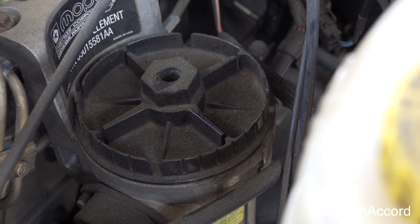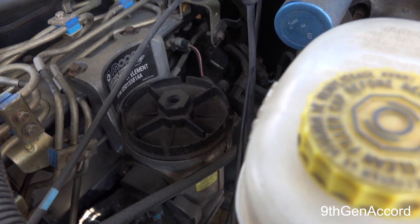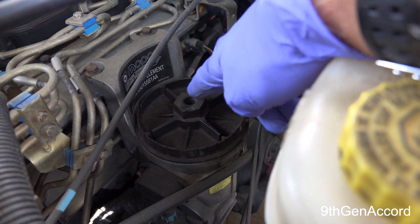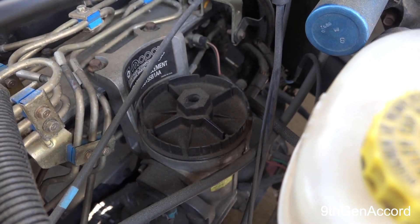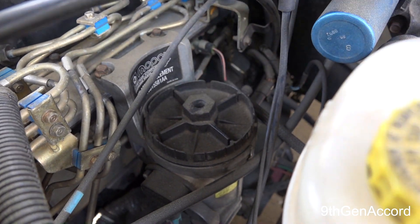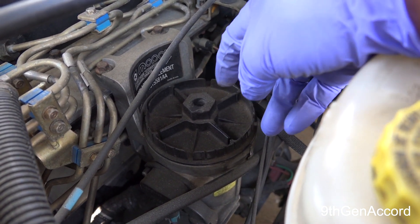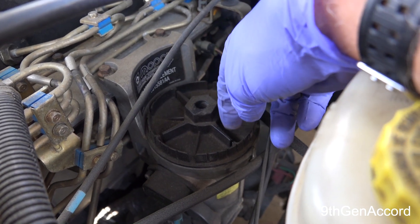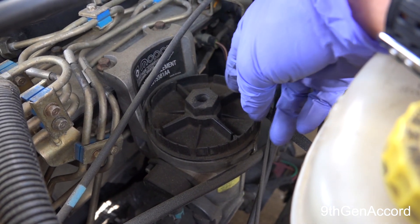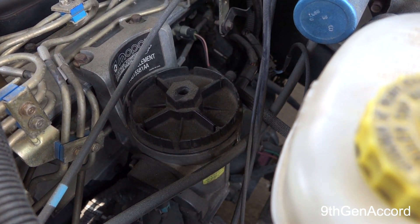I look back in my records and it has been three years since I last changed the fuel filter. I'm going to loosen the cap, use my extractor to suck out the fuel that's in there, pull the old cartridge element out, replace the O-ring on the cap, and reinstall it. I'll also show you how to cycle the fuel pump without starting the engine so that you don't starve the injection pump for fuel — that's very important.